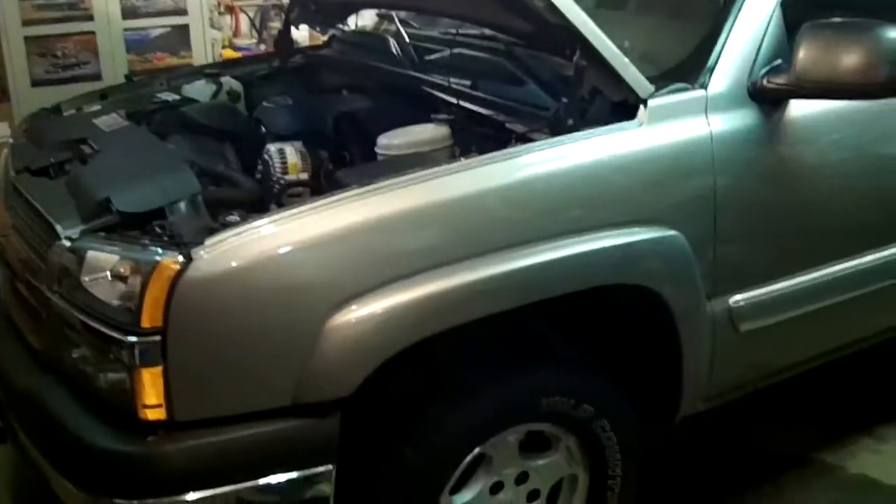I'm about at the limit of my mechanical ability, but I did learn a lot on this little pain in the ass and it was worth it for the experience alone. The alternator had been replaced but was going to need replacing again shortly due to bearings — it didn't pass the charging test consistently. Looking back, I'm okay with it because we discovered rodent damage we were able to take care of. The truck looks really nice now, standing pretty tall.